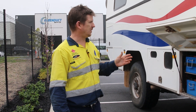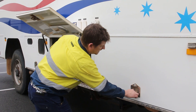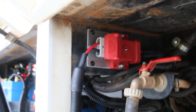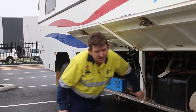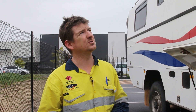Everything is completely sealed, allowing no dust, dirt, or moisture getting into the cab. We also have an Anderson connector here through its own 50-amp MPPT regulator, connected up with the links to Anderson so we can have another 600 watts of solar with two 300-watt blankets connected up. So on the roof we've got about 840 watts of solar, with an extra 600 watts with blankets allowed on the ground — we've definitely beefed it up enough to charge these batteries.